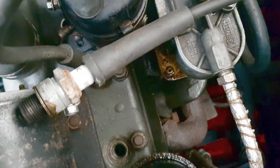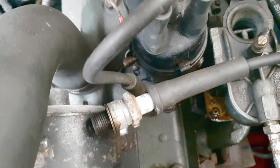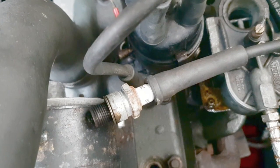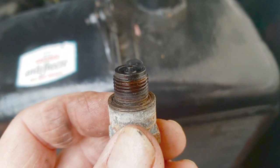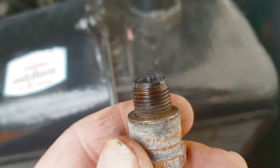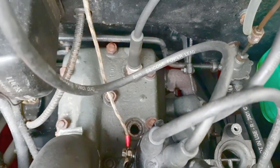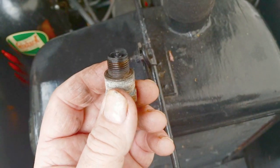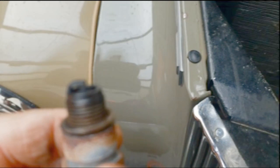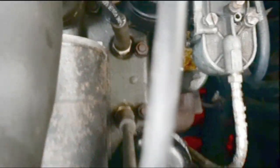Your jets are free, I poured fuel directly in — so something's not right. You were working when you came in here. I wonder if it's bad fuel, although I've just poured some fresh fuel in. Let's get them all out and have a look, one at a time. The number three plug is soaking wet — that could be flooded. These two are dry. Number four is soaking wet as well. So dry at the front, wet at the back.